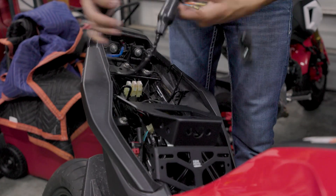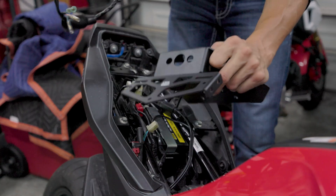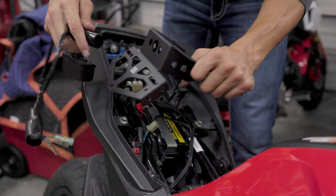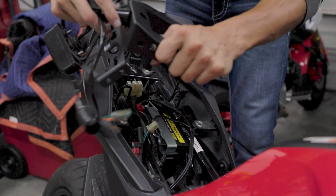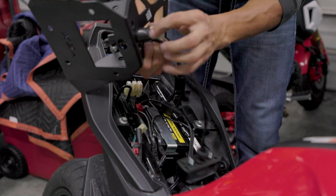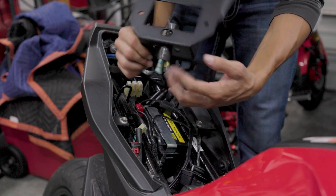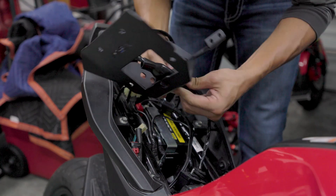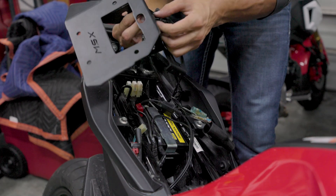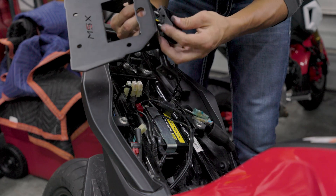By prepped, all we've got to do is take the wiring harness, the tag light and all that stuff, and fish it through the holes they've got here. They've left plenty of room to fit all this stuff in here. So all we're going to do is stick this stuff through from the outside going in. The biggest struggle for this is all this rubber — these little rubber boots that Honda puts on all their things. That's the biggest struggle. But once we get those through, we'll be good to go. That's the nice thing I really like about this Kemimoto kit: it allows you to use all the stock components from the Grom, so it doesn't look all weird and Frankenstein — everything looks really, really good, like it's supposed to be like that.